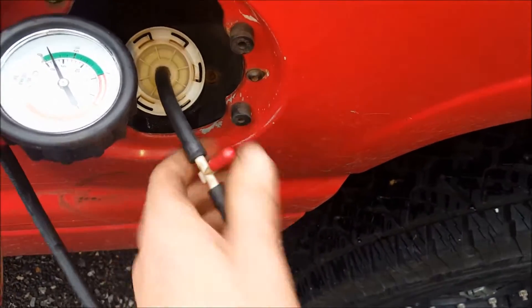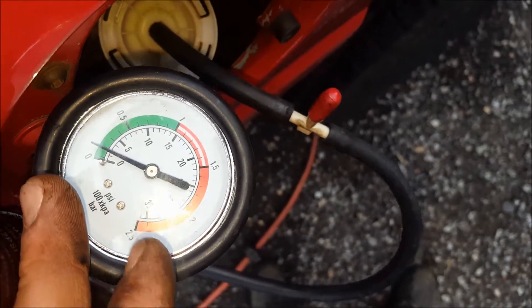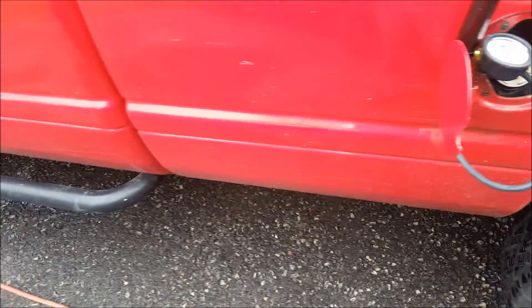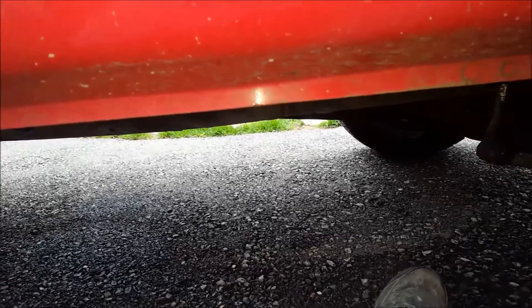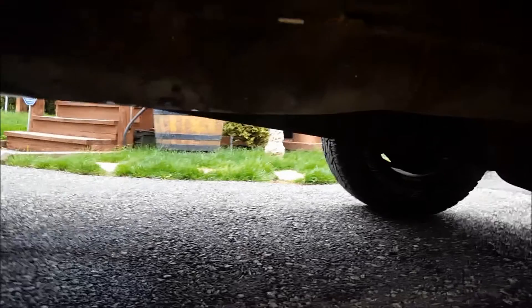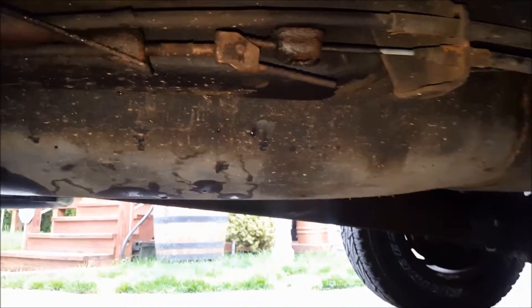I ended up adding a T to fill it with an air hose because this tank only has a half tank in it, so it was a little tough filling it up. I filled it up with about 4 PSI. It's been sitting for 15 minutes now. I've checked all my connections up front and underneath — I don't see any liquid at all. Now, that doesn't mean they're not bad because a vacuum leak and a pressure leak are very different. You might have something pulling vacuum air through, but pressurize it with 4 or 5 PSI and get nothing. I wouldn't go much above 5 PSI on this plastic tank.